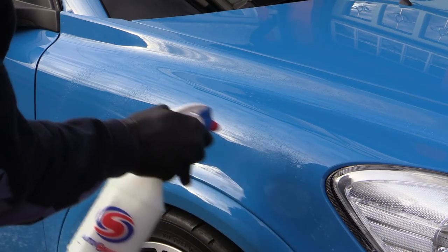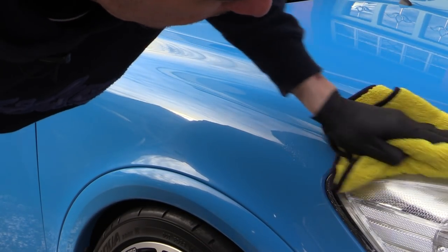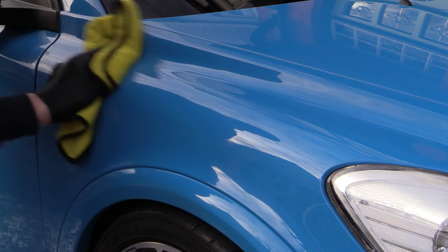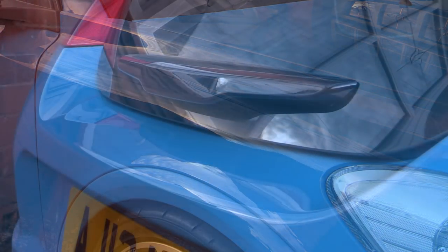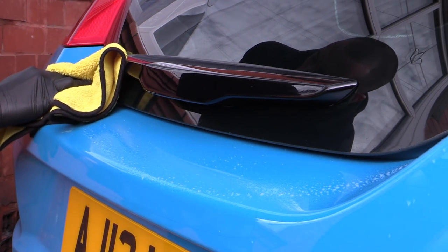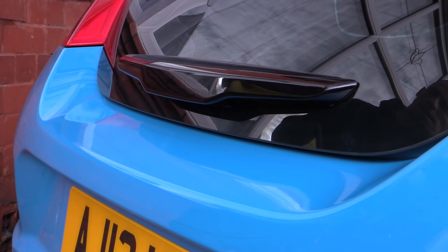Despite how unsightly the paintwork looked at the beginning, the salt itself shouldn't cause any lasting marks. However, because the car lives outside, it does suffer from some periodic water spotting. Therefore, I thought a product designed to combat this certainly wouldn't hurt. The FSE's formula makes use of the citrusy limonene extract to break down stubborn mineral deposits, and although it can technically be used on all areas, because it's essentially acid-based, care should be taken on any sensitive surfaces.